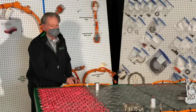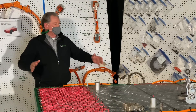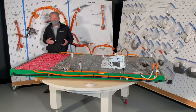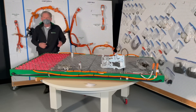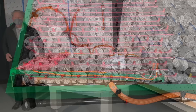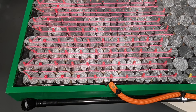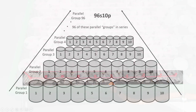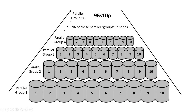There are four sections in here that make up this battery pack, but there are no lines of demarcation between them. These right here are running in parallel, so you can see the cells in parallel — they're basically their own little entity. In essence, what you're looking at is 96 groups in series.